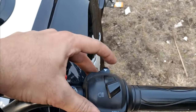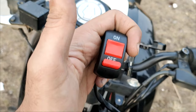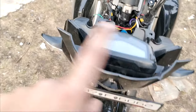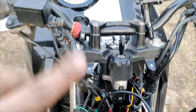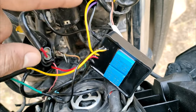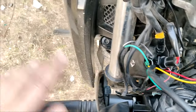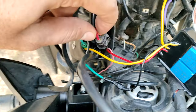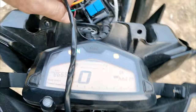Otherwise, it will be dragged. We have to connect it with the switch. If the switch is on, we only need that one connection — we won't have to do the one-by-one indicator wiring. The flasher has two yellow wires — one going into one indicator and the other going into another indicator. The red wire goes to ignition. We join the negative and connect the switch.